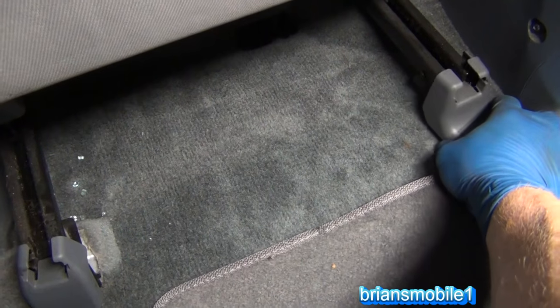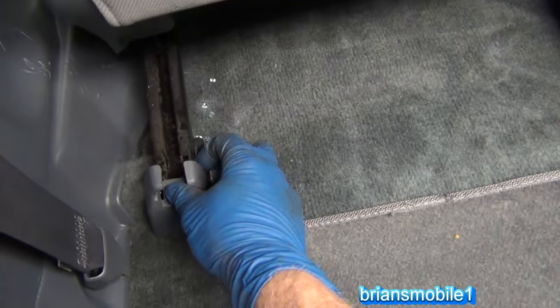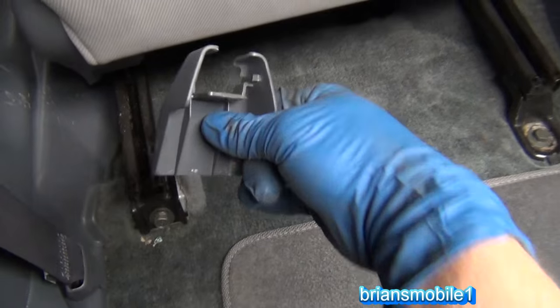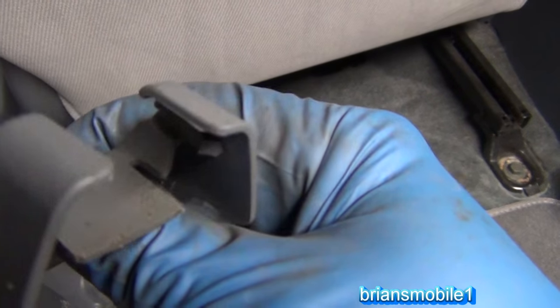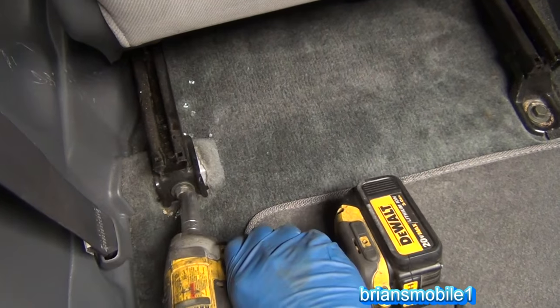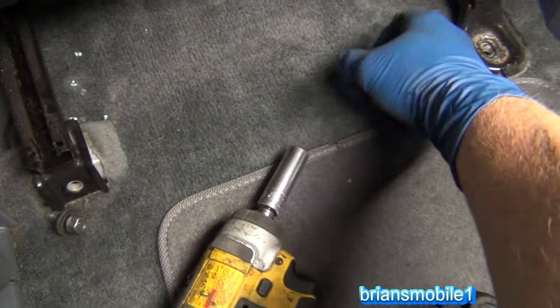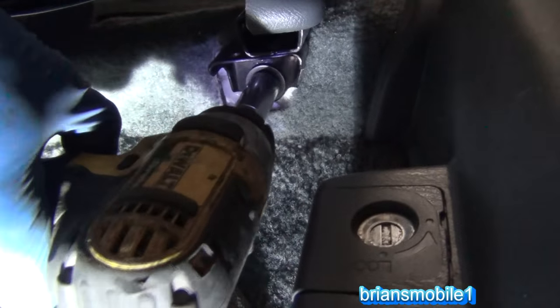With the seat all the way forward, you pull these covers off — wiggle them, pull them, pry them each way. This one clips on here and on the sides. I had to stage them because I really had to wrestle and experiment so I didn't break the plastic. But you can see the clip there and the clip right there. Once those are out of the way, you can use a 14-millimeter socket. There's a link in the description for this super fun air-compressor-less tool. Then we go up to the front — a little harder to get through — and then the one on the left. Now we're free to tip back.